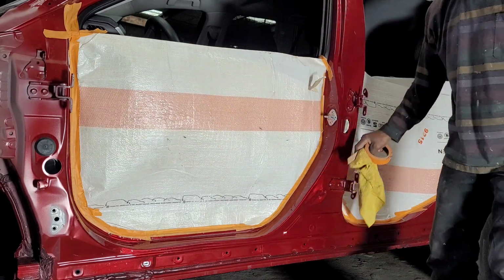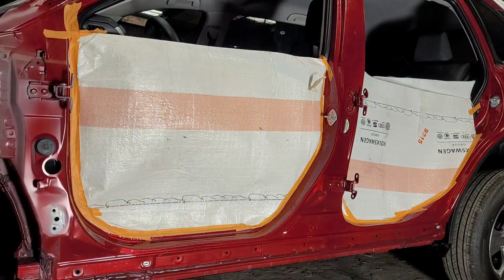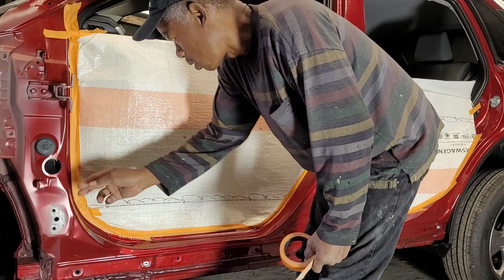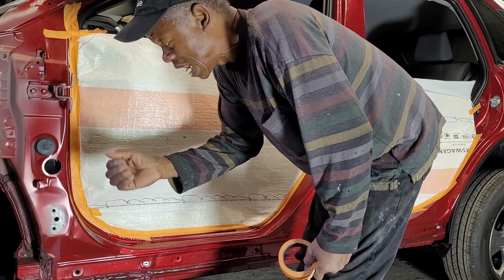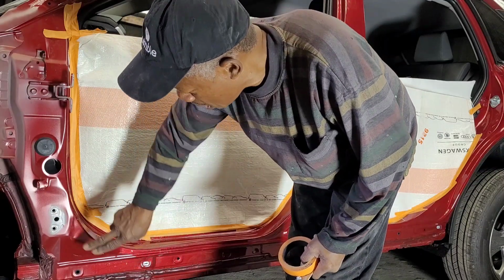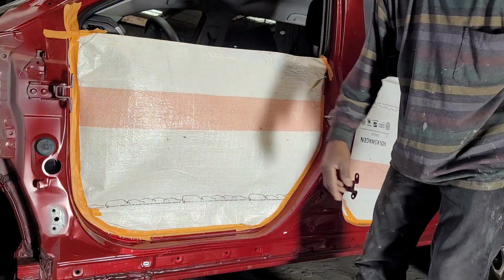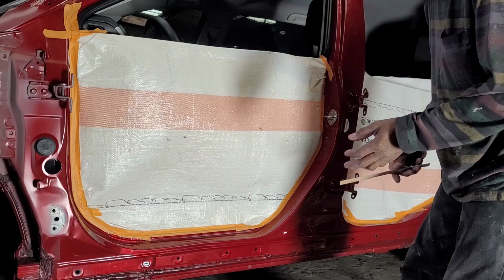All right, so let me start with removing the paint. Let's see. Yeah, removing the paint on this here, on the edge. I weld the plate, maybe 3 spots, and then I'll slap it with a slap hammer. Put my clamp on that plate, and I'll slap that out. Then I'll pop the inside here out. Get that level. Do the same thing here. This I might just drill a hole, pop that out with a dent puller, and weld the hole back in. Alright, so I'll try to use the quickest way for me to get this thing solved.